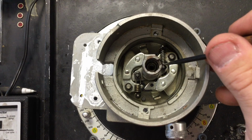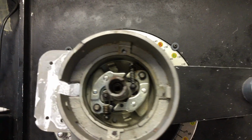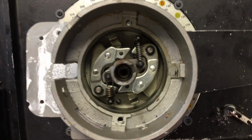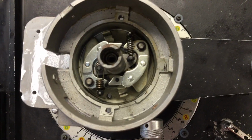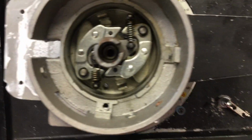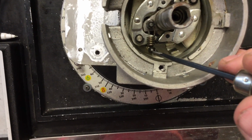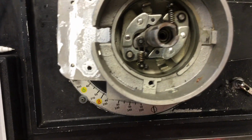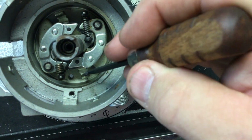But the interesting thing is all that does is return everything back to zero because you got the slop and spring. It's actually a really cool system. It's a great system. You only got to make one extra spring, the spring with the loop in it right here. If they just made a couple different versions of this spring, we could change the curve. It's very simple to control how much mechanical advance it pulls by these tabs.